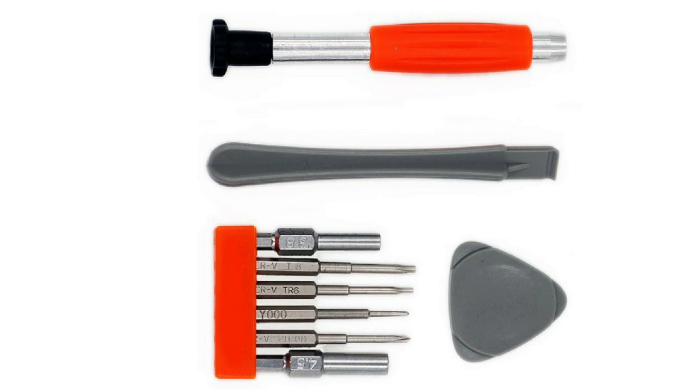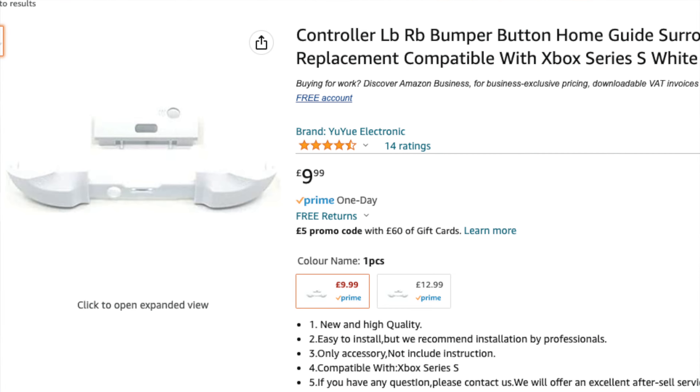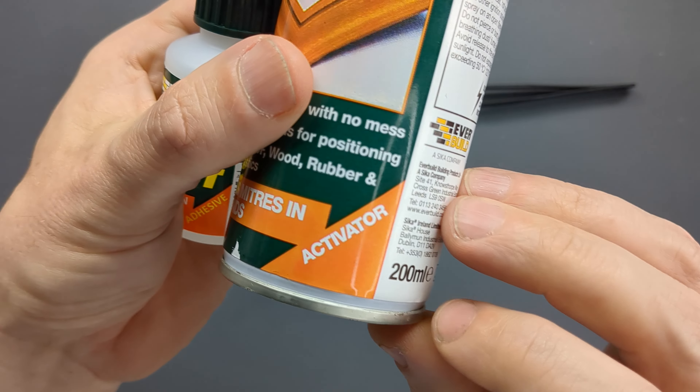To open up the controller, you'll need a prying tool like a spudger, as well as a T8 security screwdriver bit. If you end up replacing parts, you would possibly also need new switches, which is a more involved job, but it's actually more likely that you'll just need a replacement bumper strip — a plastic part that can be easily found online for around £10. Alternatively, if you want to fix any broken plastic parts yourself, you'll ideally need a decent adhesive. I used super glue with a spray activator, and I'll leave links in the description for any tools or parts you might need.